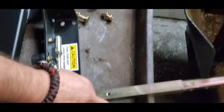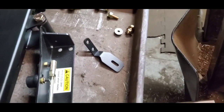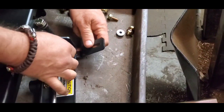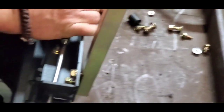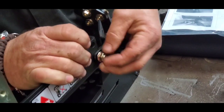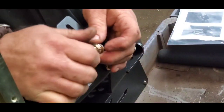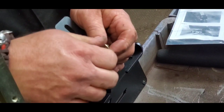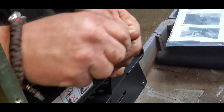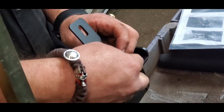Again, we're doing a 54-inch deck, so when we put this on we want to make sure that this bracket is on the back side of your quick shield. This allows for the clearance so that when the door opens up it's not slapping metal on metal - it's resting up against the rubber bumper so you're not getting that vibration and clang whenever you open it up.